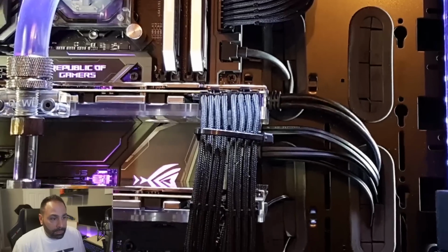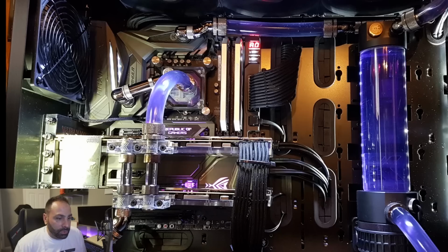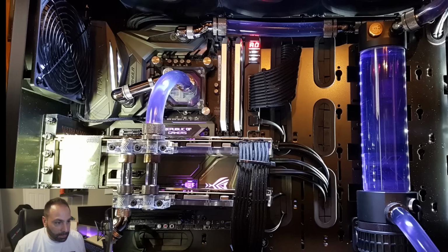These SATA cables, I would have liked to see routed. I don't know why he chose to put them through this grommet as opposed to this grommet, because you definitely could have. Maybe it was a tight radius bend to make with the cables, and you didn't want to risk damaging anything. The USB 3 is a little bit of a different animal just because of how stiff that portion of the cable actually is. It would have been difficult to make the bend into this grommet right here.